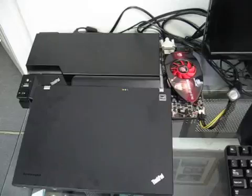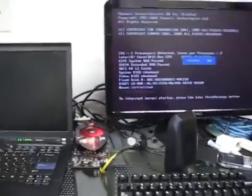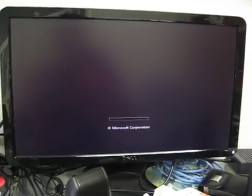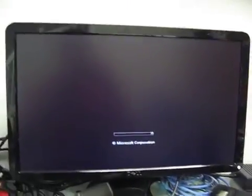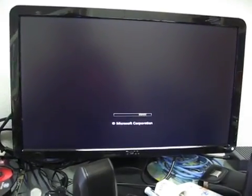All this may seem a little technical but it's actually not that complicated, so I'll walk you through a video of the setup running and tell you what everything's doing as we go along. You can see here my laptop, which is a ThinkPad T400 — it's currently connected to the Advanced Dock. Turning it on, you can see that triggered the graphics card to turn on as well and the fan is spinning. There's an extra power cable going into the graphics card that is connected to an external power source which I made. The setup boots up on this external monitor, which is required because there's no reasonable way I found to route the video back into the laptop monitor.